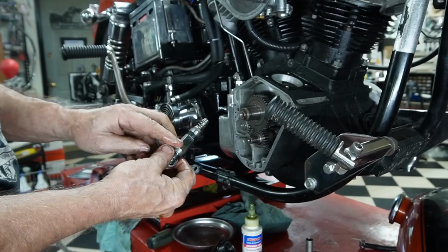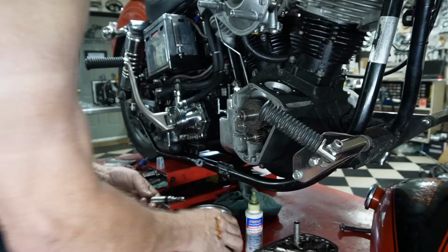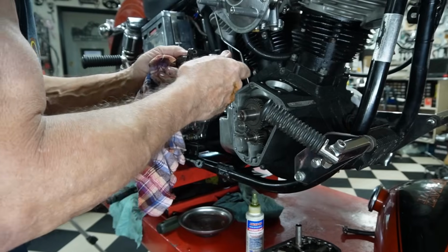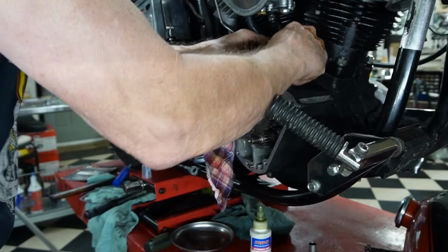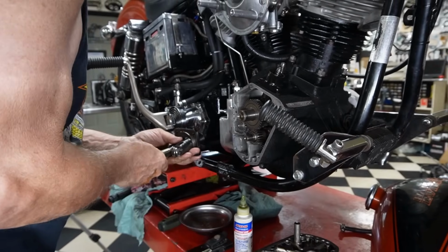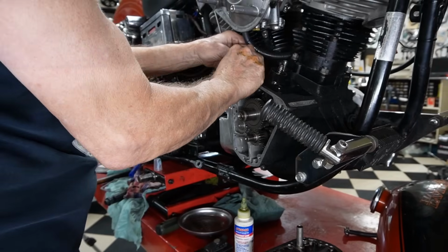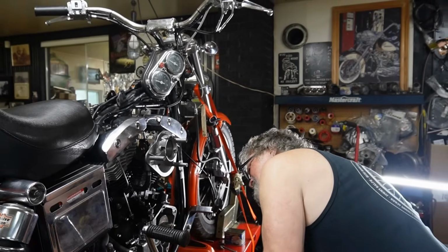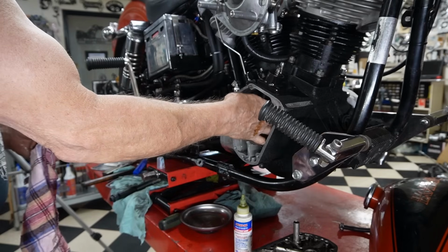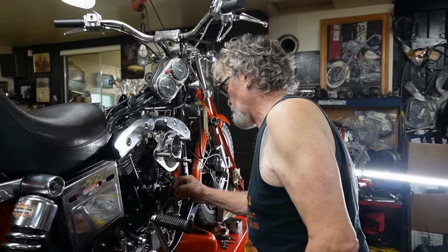And we're always making sure that the small oil holes have to be fitting inward on your blocks. So which have I got here? So they have to be facing inwards towards the center, as that's where the holes are. And we'll kind of hold these and ease it down in there. I already got a little lube on them. A little trickier. Okay, I'll find my lifter block screws and get ready to put those in. So we get our little screws in place.